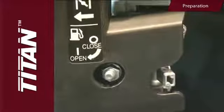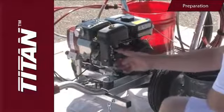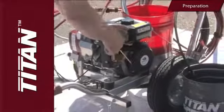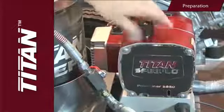Move the engine on/off switch to the on position to start your engine. Move the fuel shutoff valve lever into the open position, then move the throttle lever away from the gas tank. Move the engine choke lever to the closed position. Now pull start the engine.